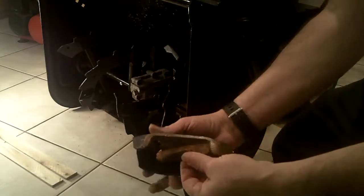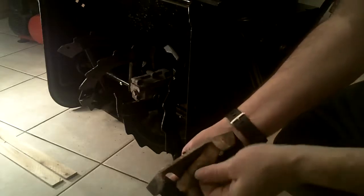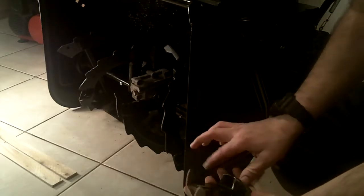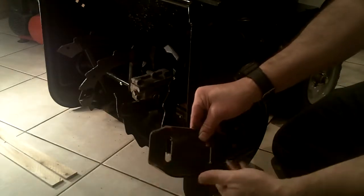I guess I could have hit these with a little WD-40 at first, but they're coming alright. Alright, nut, washer, carriage bolts are still sticking through. As you can see, this guy's totally worn out to the point where this piece is coming off, and I'm going to just go ahead and take that the rest of the way off. But we can install it this way and get more life out of it using the bottom part for our shoe.